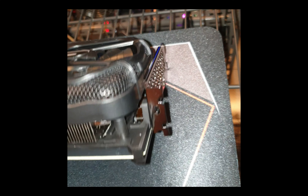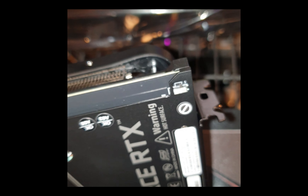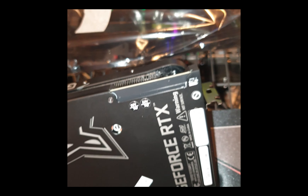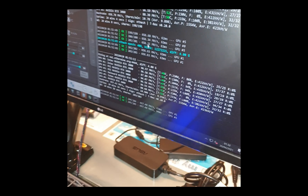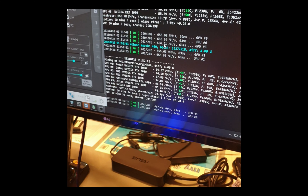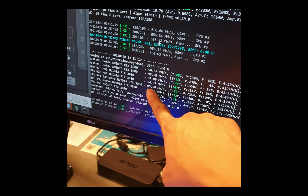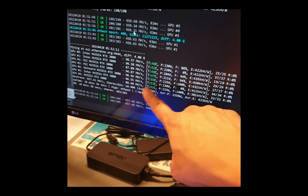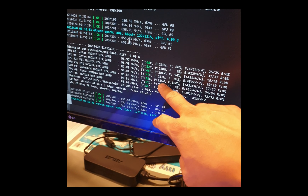Warning - this is a hot surface, you shouldn't touch it during mining. I'm not sure if the button is for OC or silent mode - I'll look it up online before I change it. I already installed the Gainward and I'm reaching 96.56 megahash at 55 degrees Celsius, pulling around 225 watts. I believe those are the OC settings.